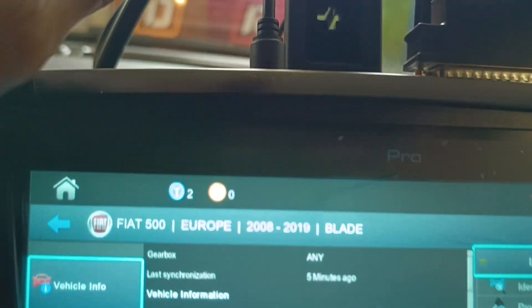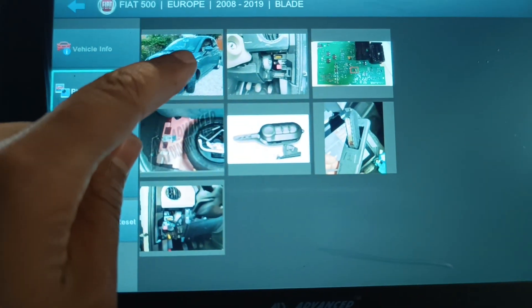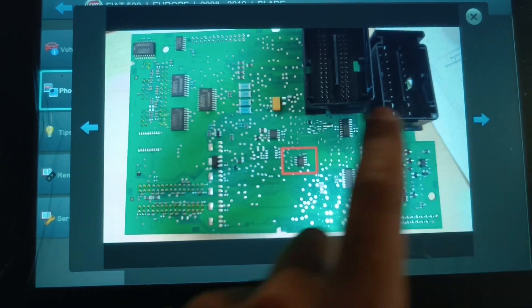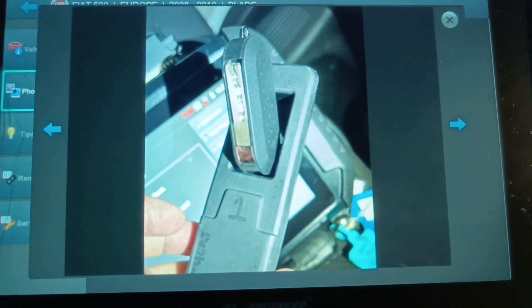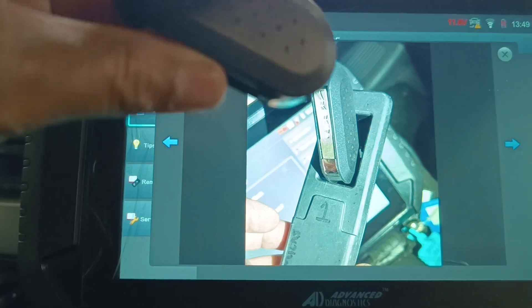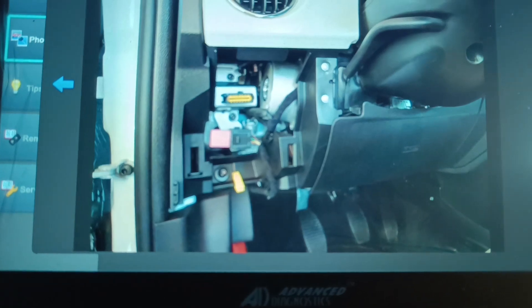A smart aerial is required — this device here — it is required and we've got it connected in already. So we can go through to the photos and it gives you a photo of what the car looks like. There's the OBD location and that's what the remote key looks like. When you're pre-coding the key, which we're going to go into in a minute, you're going to fold the blade away like it is in the picture and hold it with the bump sides like this so it matches the picture exactly at that angle.